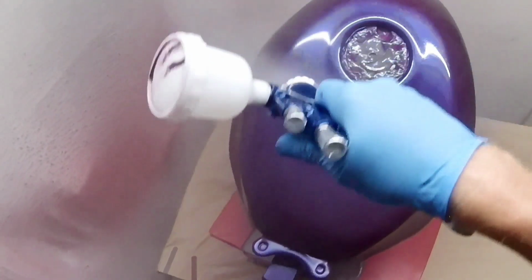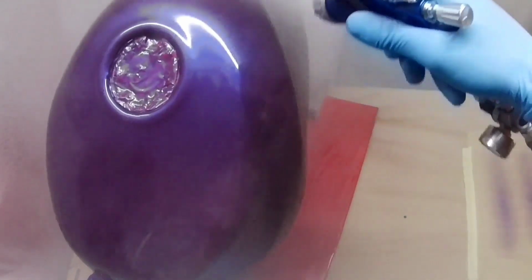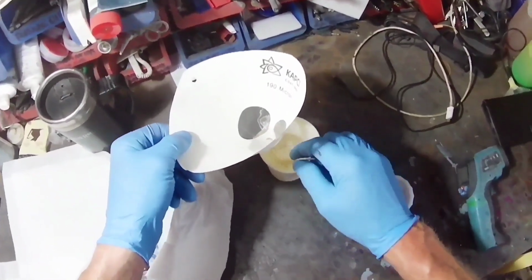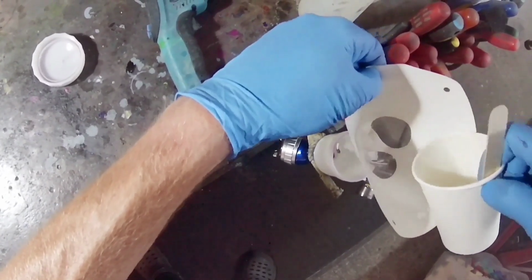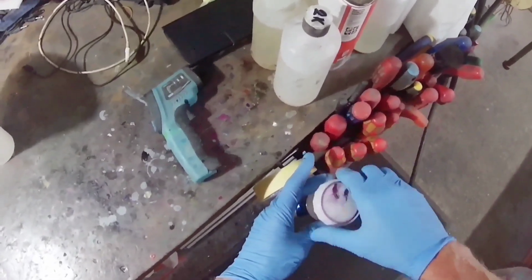The only time I actually come across a problem is on rare occasions in the UK when it's warm, and you've got a lot of small parts to do, so the stuff will be in the gun for probably 30-40 minutes. What I've been using lately is a Capsi clear coat I've got, which has what they call a fast hardener, which is very much a standard hardener. It stays live for over an hour in the pot, so I use something like that, and that gets me through it absolutely fine. You know, just doing lots of small stuff because of the positioning. In my circumstances, I can't line it all up and do it at once, so I have to do something, move it, do something, move it, etc.